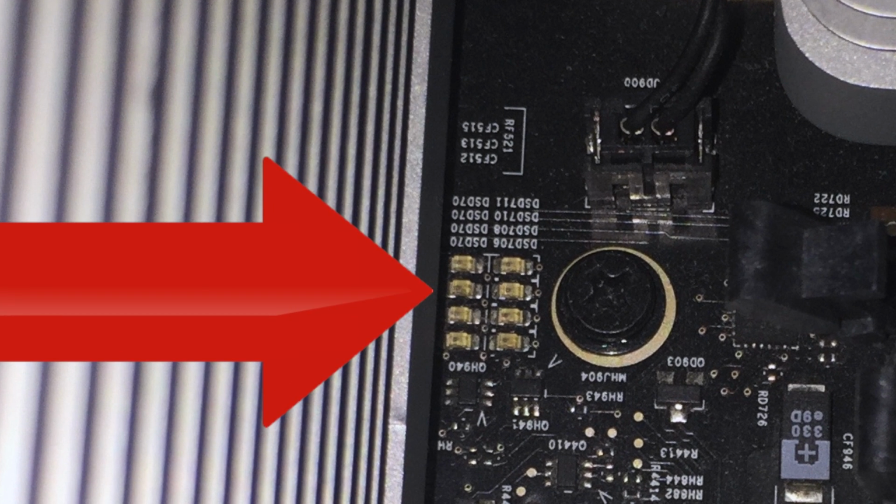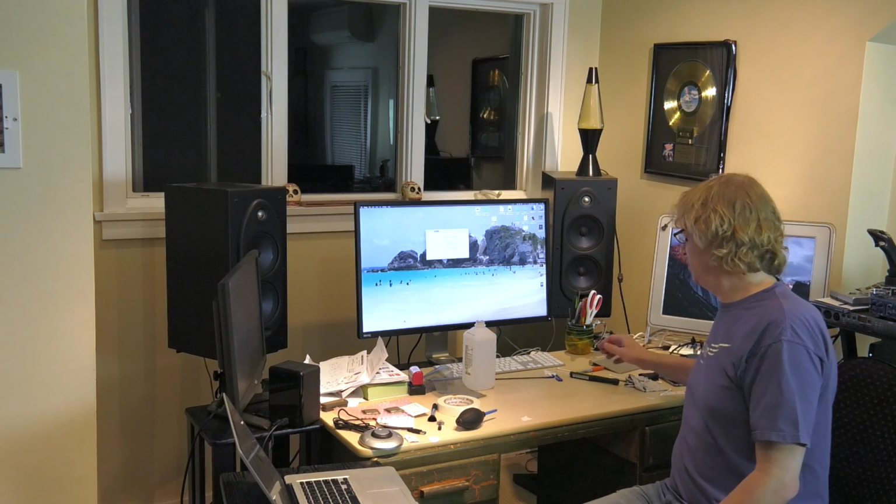So there were two chips or three chips or one chip missing. On the final one that worked, I put it back in, I didn't tighten it too much, I went very light, I booted it, it did not boot. I tightened, this is just CPU B we're talking about. So CPU B, I tightened it just a little more and it booted. But then one chip was still not showing up. So I did another tightening all the way around, one more quarter screw, and bingo.